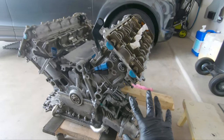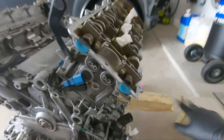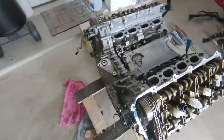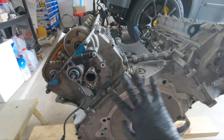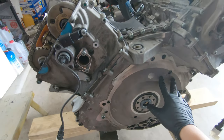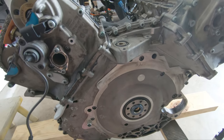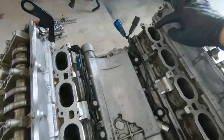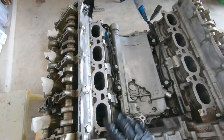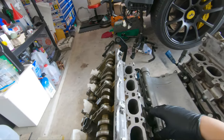In the last video, I went ahead and removed all the accessories — the headers, the AC compressor, the starter, all that stuff. I also removed the valve covers. So now I'm going to start removing the rear timing cover, and the main central one right here. Then we'll be able to take off the heads and really see what damage is in each cylinder wall. We know for sure cylinder 1 got the worst of it, and cylinders 3 through 8 — I'll see if there is any more visual damage on the inside.